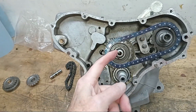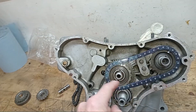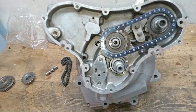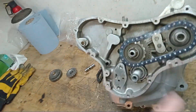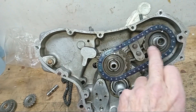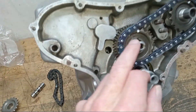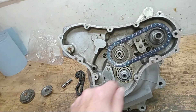The chain was tight in one place and loose in another. Now if the intermediate shaft had been bent - which can happen quite easily - because the actual spindle isn't moving it won't run eccentrically; it might make the whole thing tight or loose, but the only thing that would run eccentrically would be the actual camshaft. Anyway, I've replaced that now. I've taken all the cases apart several times to put the chains and camshaft over, and what I've ended up with is the original camshaft back in, the original sprockets, the new cam chain, and I've replaced the intermediate spindle.